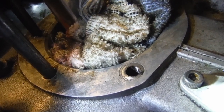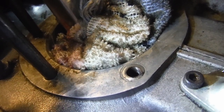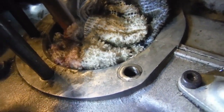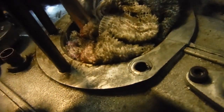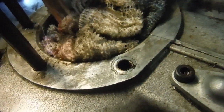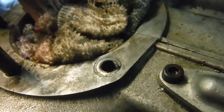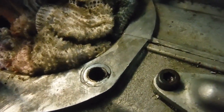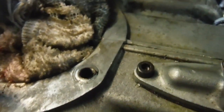With a vice and a handheld tap mandrel, so I put the tap in the tailstock chuck of the lathe and put this drilled-out bolt shank into the main chuck of the lathe, and started off the thread cutting there. Then I took it out and carried on carefully by hand, because being high tensile it's very tough stuff and I didn't want to break the tap or cause any harm.